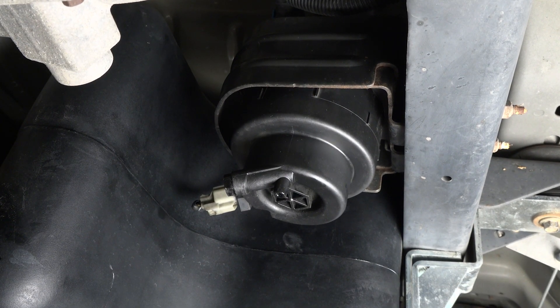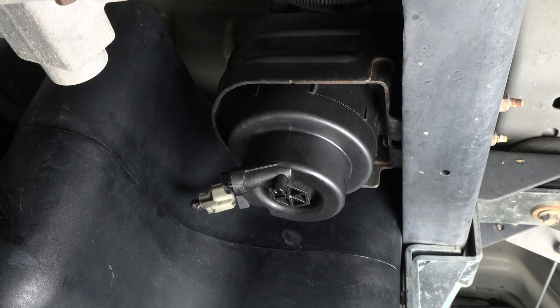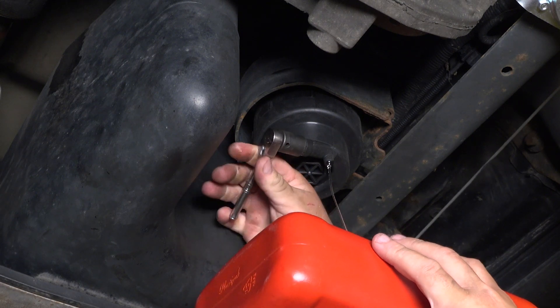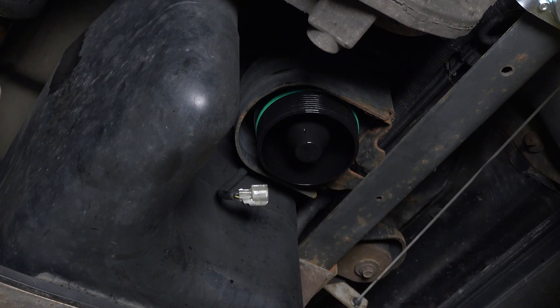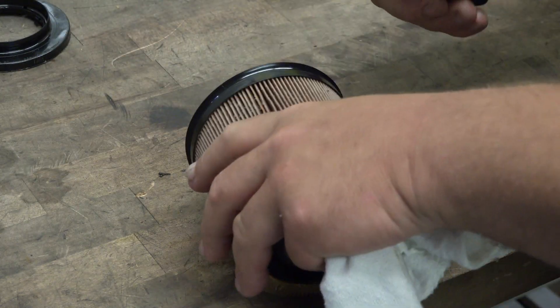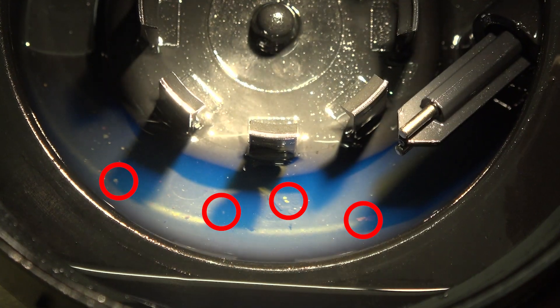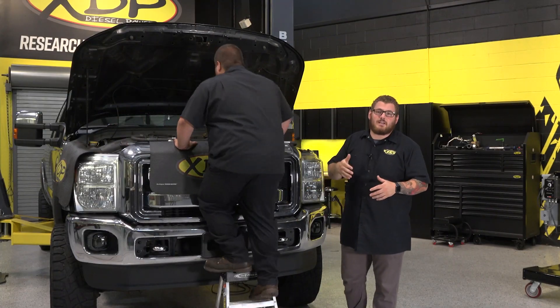We'll start by pulling the lower filter and checking for any debris or metal shavings that may be present. We've cut the lower filter and can see that we do have some debris present. Not all metal in the bottom is the same — some rust-looking pieces come from filler necks, possibly even parts of the sender rusting up, leaving pieces in the bottom of the basket. Some cab-chassis trucks have a full metal tank where the tank rusts internally and leaves all that rust in the bottom for the lift pump to pull up. Now, if you have metal shavings in the bottom of your filter, that's when we head toward the CP4 for a possible failure. So before we start assuming anything, we're going to take a deeper dive into our diagnosis — literally.